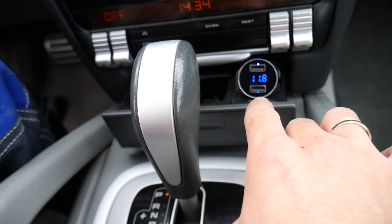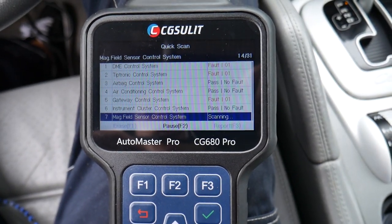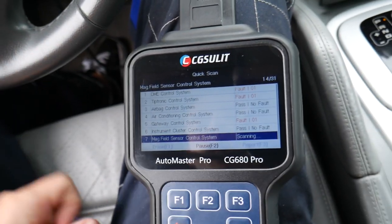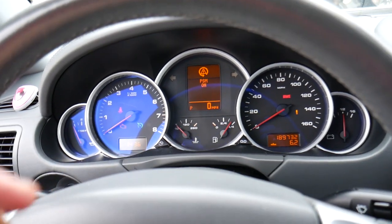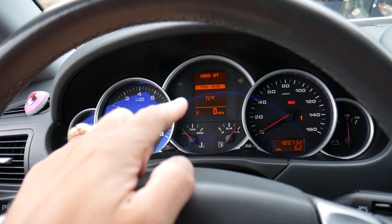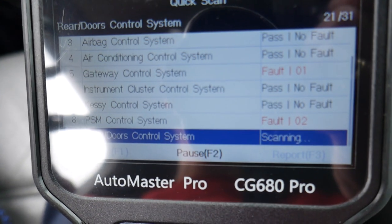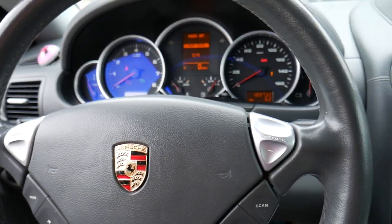I plugged in a charger — the battery is only 11.8 volts. When you do professional diagnostics, always make sure the battery is on a charger. You need above 12.5 volts for correct diagnostics — that's the number one mistake people make. If you hear the system beeping or giving warning messages, that's normal when it's accessing computers. For instance, the traction control motor may turn on when it scans the PSM system because the steering angle sensor gave us codes. Don't freak out — that's normal.